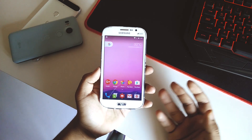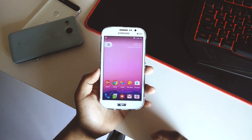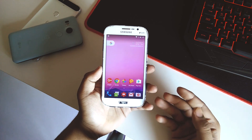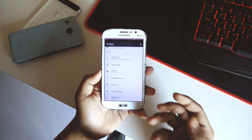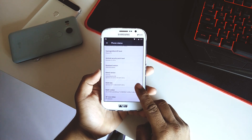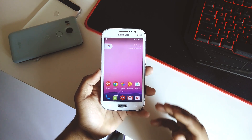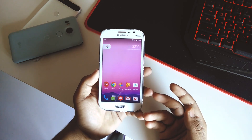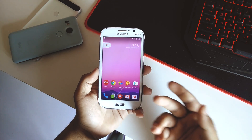Today I'll be showing you how to flash it and also giving you my initial impressions of using this ROM for around two days. First I'll be showing you the features, and at the end of the video I'll show you how to flash it onto your Samsung Galaxy Grand Duos. Make sure you have the Grand Duos itself and not the Grand 2 or other devices — the model number should be i9082. As you can see, the build number is i9082. Do not flash it on other Samsung Galaxy phones because it won't work and will probably soft brick your device.